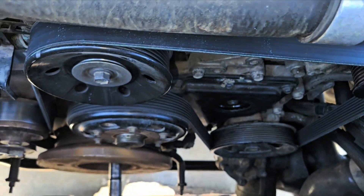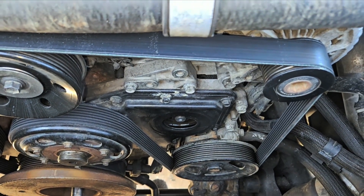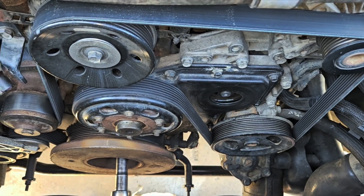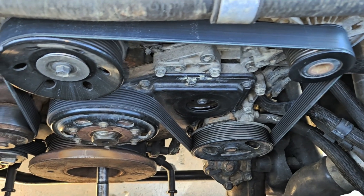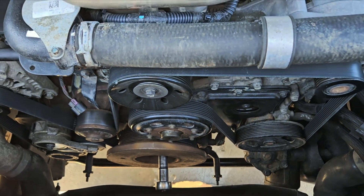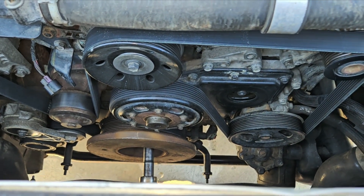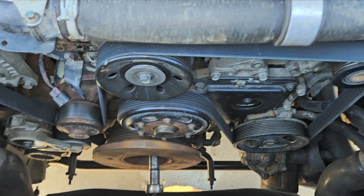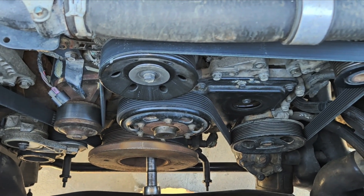In this video I'm not going to explain how to pull the nut off and get it off the chain gear to do the whole adjustment procedure — you've got to figure that out, there are instructions on it. But that's the phasing procedure: make sure you line it up like this. Anytime you change the CP3 fuel pump, you always have to make sure it's timed correctly. This is how you do it — they call it a phasing procedure.